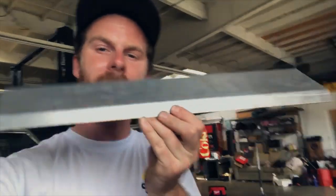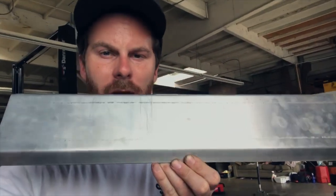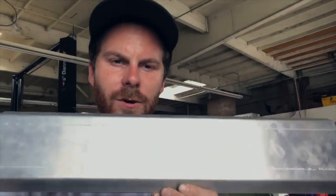Because I want this piece to bolt to the top of the fuel cell, I need to copy the holes from it and transcribe them onto this. Then presumably copy the same thing to the other side to mount to the frame. I might add a couple more holes just for support and stability, but either way it needs to have the same bolt pattern as the fuel cell in order to attach to it. So I'm going to draw that up, measure first, draw it up, cut it, and hope that it works.